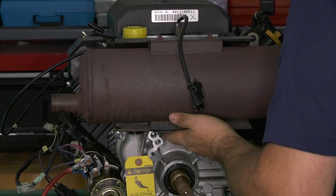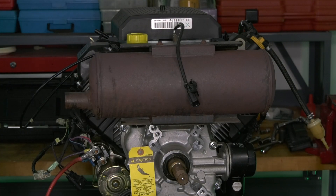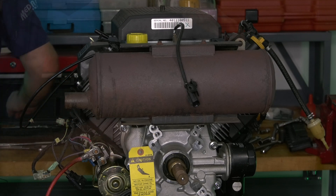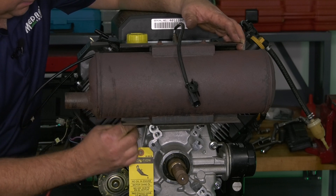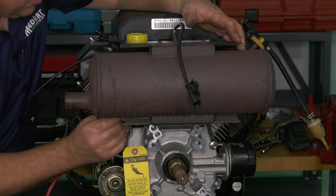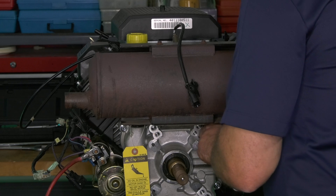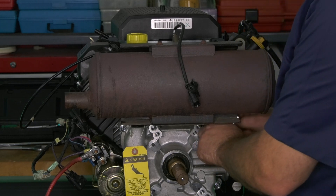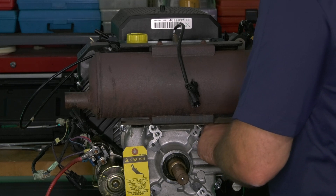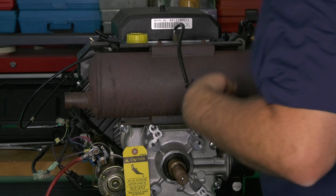Once everything is snugged up to the point of being finger tight, you want to find your 10mm wrench and go in and snug up the bolts against the block itself. Snug up the bolts to the back of the engine plate. You want to go in a procedure — never tighten one up fully. Get a mitt there to draw everything up to the position of the muffler. Again, if you put pressure on the muffler, you're going to cause problems down the road — failures of the mounting flanges, failures of the pipe going into the muffler, and just an unhappy customer all the way around.